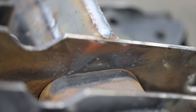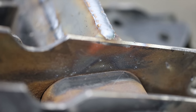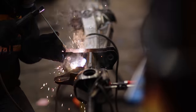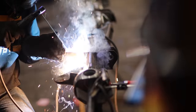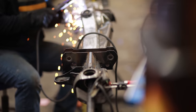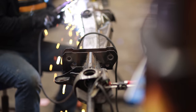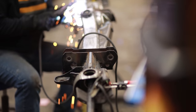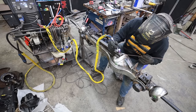For that reason I'm going to use a stick welder and get down into the area I can't clean very well, because I know there's going to be oil residue, paint, and rust. With a stick welder you can usually get a lot more forgiveness and a lot less porosity in your welds when welding super dirty material. On top of that, I'm going to add weld onto the inside of these brackets and make sure you can't see through anywhere — everything's going to be covered in weld.